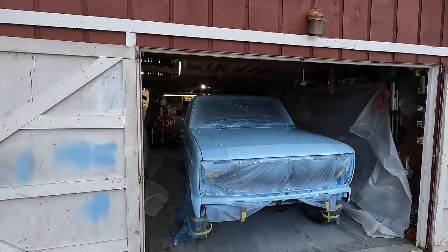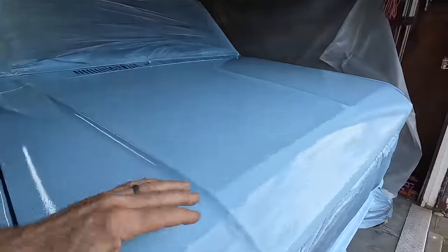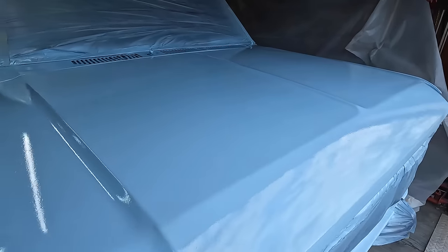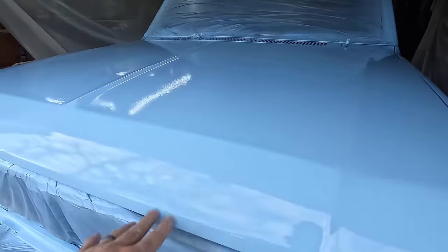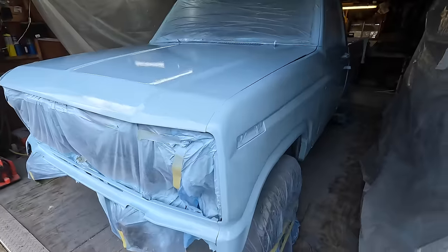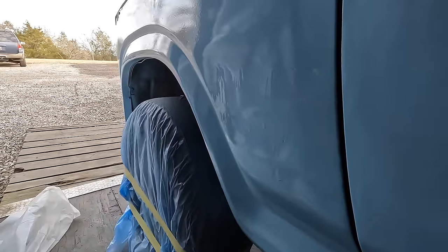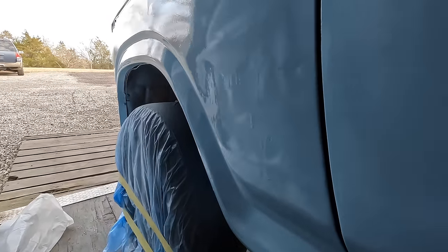It's the next day and I'm coming out to look at this — wow, it looks smooth and shiny. Before, it was all grainy. I spent a lot of time sanding the hood down and it was well worth it. You can see these drips here because the gun — I believe I oversprayed too much when it was set to 60 PSI. I think that's just the top coat, so I'm hoping I can buff that out.